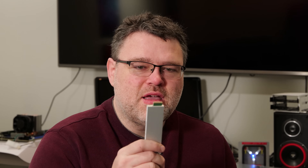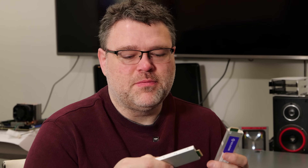Enterprise flash typically uses a U.2 form factor — at least right now. The two-and-a-half-inch drive is a 30-plus-year-old standard, and while it's cool, it doesn't fit super conveniently in a 1U rack case. And 1U is where we're going because, again, it's a density play. Everything has liquid cooling, and if everything has liquid cooling, why don't we evolve storage to have liquid cooling too?